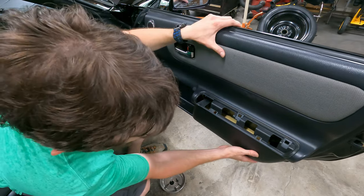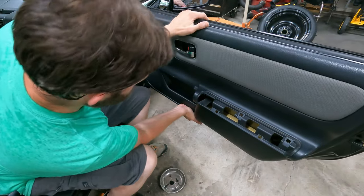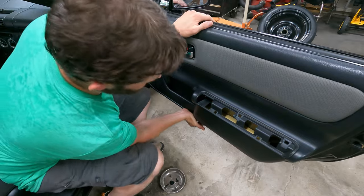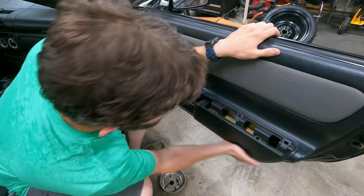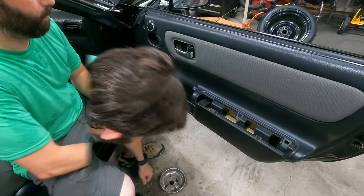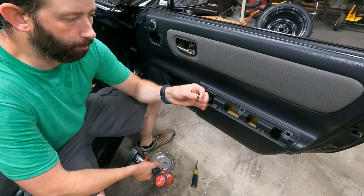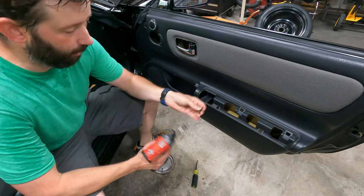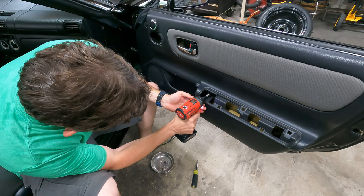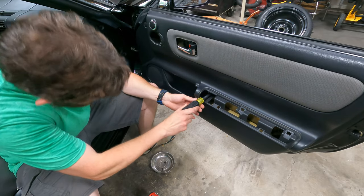You want to make sure all your pop clips are lined up perfectly, then just push it all back together. You should hear clicks and everything should be pretty tight against the door. When in doubt, just go around it a couple of times and you should be good to go. To support the door panel, we're going to put the big screw back in — it is like a wood screw but flat on the end — and that's going to go in the hole that used to go through the old handle. Tighten that up with a screwdriver.